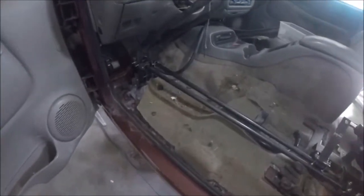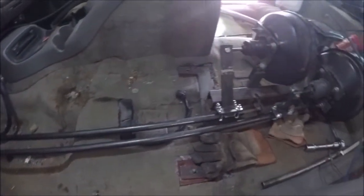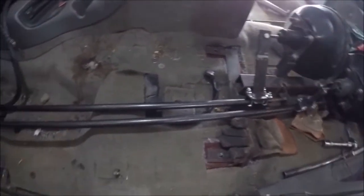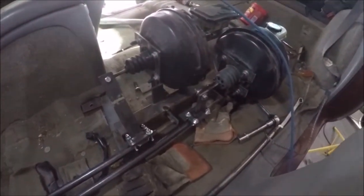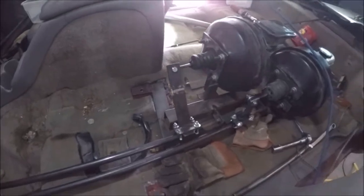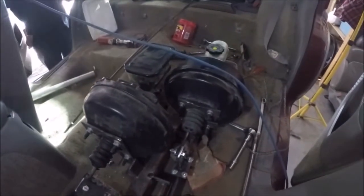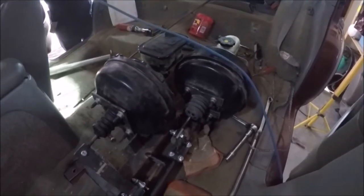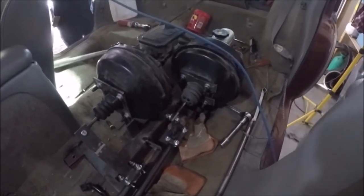Got an update on the brakes - it's done. Both brakes are hooked up and the steering arms are done. You can see I just pull this down and as I pull it down the brakes actuate - pretty happy with how that's working out. Next is to fill the brake lines up. I got new brake lines on Monday, so I'll give a little update video once we get them purged.